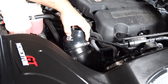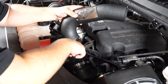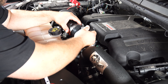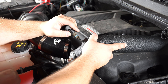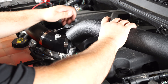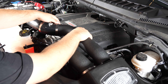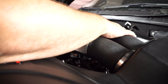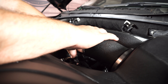Install the three-to-four-inch coupler on the driver's side inlet pipe, then install another clamp onto the coupler. Install the shorter pipe that comes with the kit onto the driver's side inlet tube. Install the other coupler onto the passenger side inlet tube with both clamps. Install the intake temperature sensor onto the other inlet tube, twist it to lock it in place, get it into the coupler and into the air filter. Install the crossover tube onto the bottom of the intakes, then go back and tighten all the clamps.